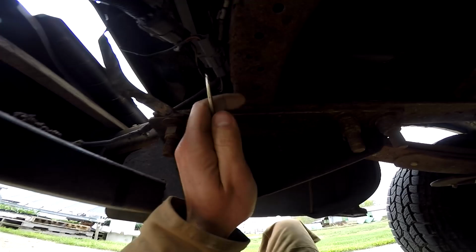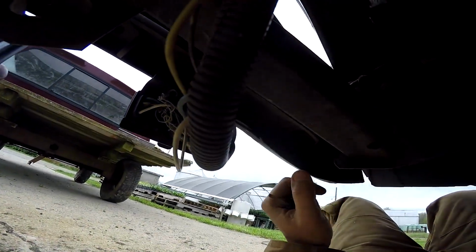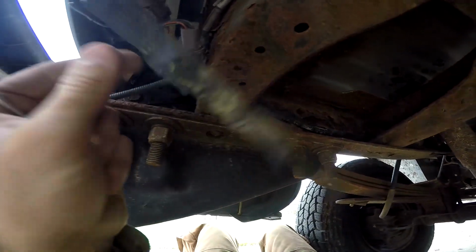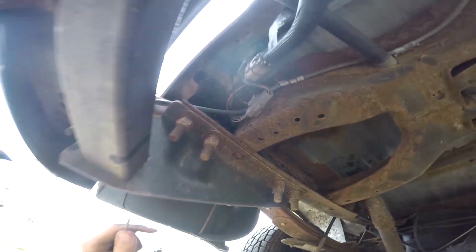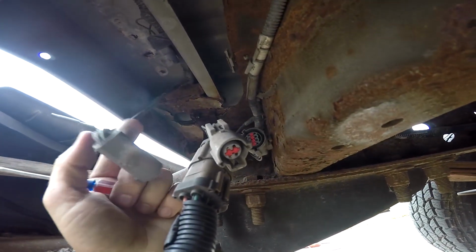Okay, back underneath the truck here, having some struggles. All these electrical clips. This one I'll have to take apart. It goes down to the trailer plug-in, and since that is down on the bumper, that's not coming off, we'll leave that one. This clip here goes to the lights, and we have a clip up here that goes to the tail lights for the wires. These aren't made to come apart. I mean, they will come apart, but a lot of things from the factory are one-time deals, especially our vehicles nowadays. Nobody else can work on them. Wish I would have thought of that sooner. A little gap there. Push on the tab and twist to spread it apart. Okay, those stay with the truck. That goes with the bed. Those go with the bed.